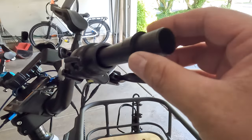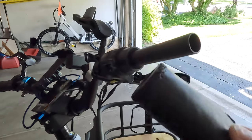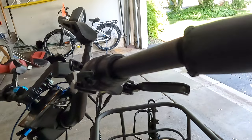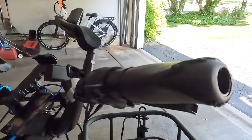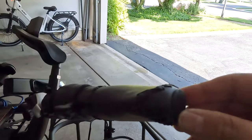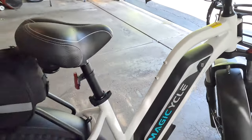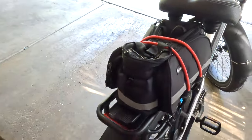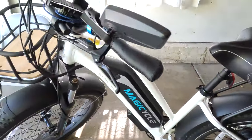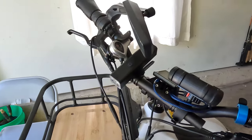Now we've got to press this in while we align the brake pads — I need something to hold it in place, like a thick rubber band or clamp. I couldn't find a rubber band so I just put some duct tape on it — duct tape comes in handy for everything. That's holding it in place with the brake pads being pushed together, so now I know it's aligned and I can tighten these up. We also need to slide the retaining spacer back in, and then put the grip back on. Some people put alcohol inside because it'll slide on easier, then when it burns off it'll be tight. That wasn't hard to do. Just put the end cap on and believe it or not, folks — it's done!